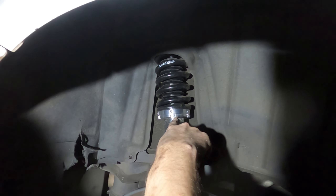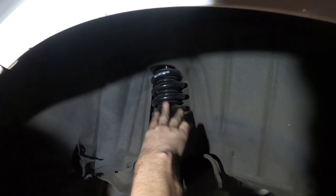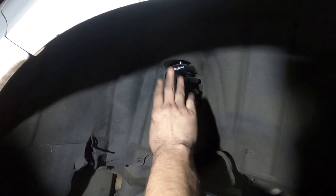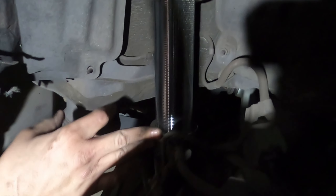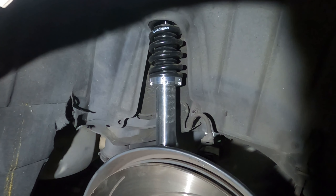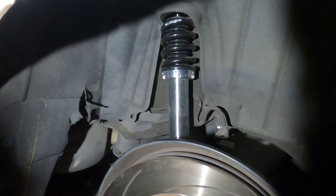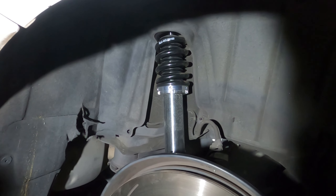You can actually lay frame without adjusting the preload on these. In general, don't mess with preload on one-piece coilovers with an adjustable bottom mount — people coming from ground control coilover sleeves often mistakenly adjust it. Tighten the preload collar and leave it. All height adjustments should be done from the bottom mount. Loosen the lower collar, twist the entire assembly — twist in to go down, twist out to go up. On these in particular, every 12 threads equals approximately one inch of height change. Count your threads with a pick tool, then double-check with a measuring tape.